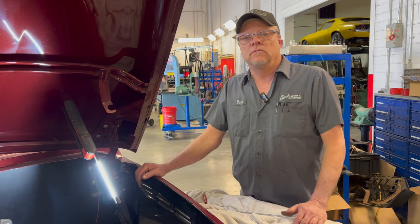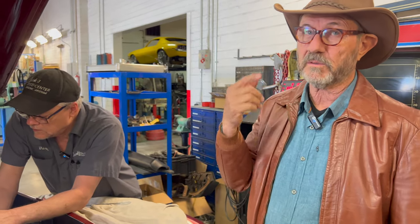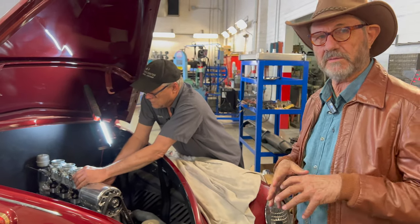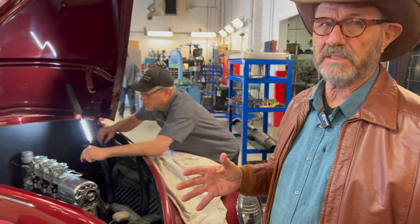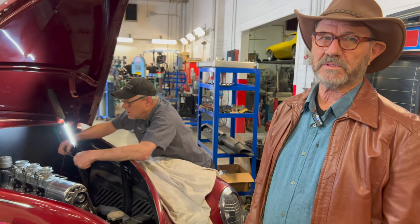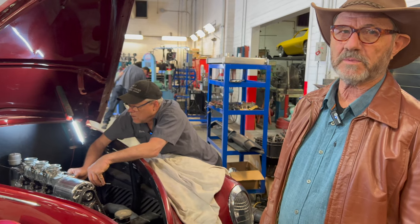There is such a thing as just right. There is, absolutely. You can over carburetor very easily. You kill performance, not add to it. More is not always better. It's a balancing act. Exactly. You want it to come on early, so it needs to be very small. If you want to build as the need comes to you, but you don't want it to dump in there. That was Don Roberts' favorite theory, that too many carburetors is what kills the bottom end performance of a lot of cars.